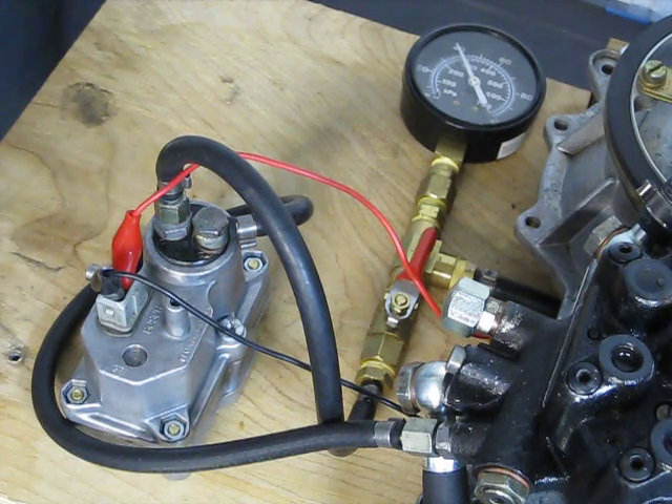Basically, when that heating element relieves from the spring, it raises the pressure which leans out the mixture as your car warms up. You need less fuel to keep it running, keep it idling. It's also efficient.